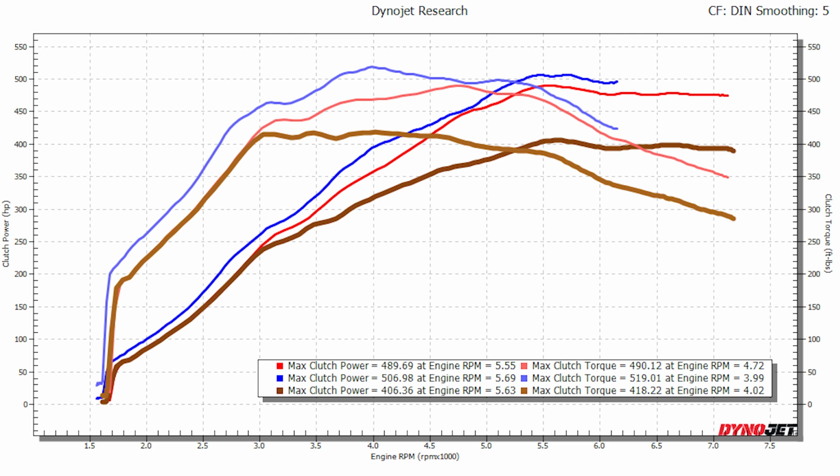What's your feeling about how the car performed in the logs, etc.? Is there anything you saw untoward? Nothing untoward. The way the box works is it relies on the ECU to make the adjustments to the fuel and the fuel trims, all well within factory specification. I've seen some tunes out there that are horrendous on the fuel trims, much worse than what you'd see from the tuning box. It's never going to be 100% on the trims because you don't have the capabilities that you do from a proper ECU tune, but that's a product of what it is.